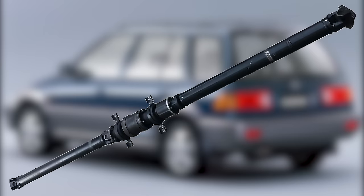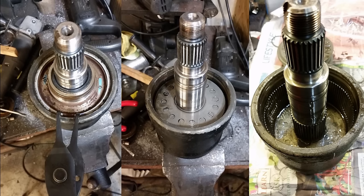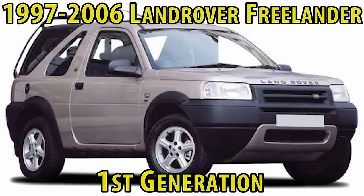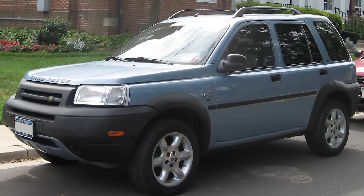The Civic wagon drive shaft may not be adequate beyond 400 horsepower, so you may have to upgrade it to the larger 1310 U-joints. The viscous coupling can be serviced by removing the C-clip to check for wear and change out the silicone oil. The Civic wagon's viscous coupling has been used on 1300 horsepower setups. The next popular alternative viscous coupled drive shaft is from the 1997 to 2006 Land Rover Freelander — it doesn't matter if it's from an automatic or manual because they're both the same. The Freelander drive shaft has larger joints than the Civic wagon's and should be good up to 800 horsepower in stock form. The viscous coupling is seam welded so in order to do maintenance you'll have to open the welds up and weld it back, or buy a new or refurbished viscous coupling. There look to be aftermarket offerings coming out, which may be a better option compared to trying to find one from a wagon or Land Rover, which can be rare, expensive, high mileage, require maintenance and have a sketchy history.